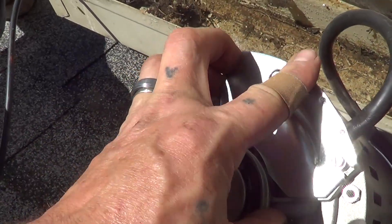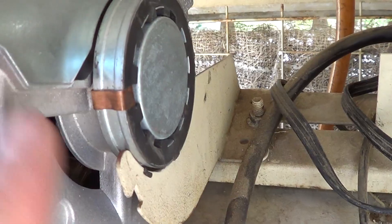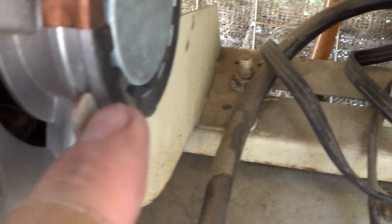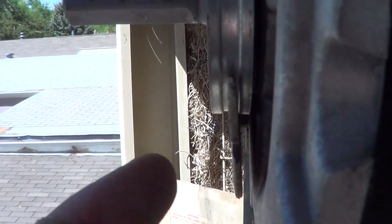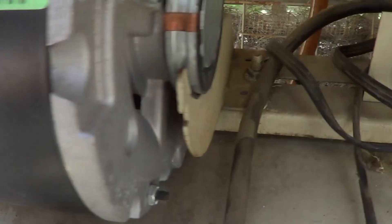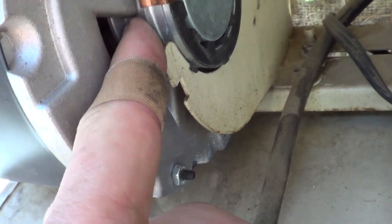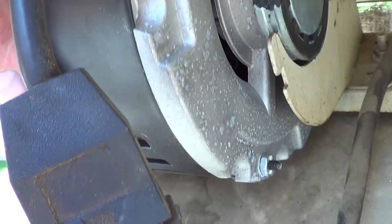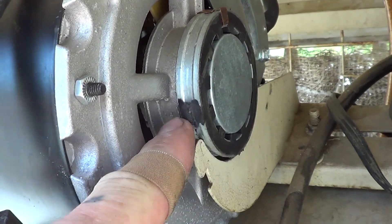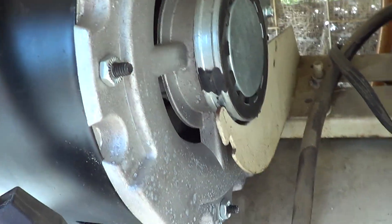Push down and tighten the screws. Now we've got the plug back on. Set the motor right back down where it goes — you can see that little piece fits inside the grooves on the motor. Tighten that down on both sides, making sure the metal piece is in line with the groove and the rubber grommet is in place. Also check if your motor says 'this side up' and has an oil spout — make sure that oil spout faces at least level or upward so oil flows in correctly.